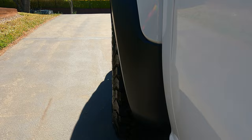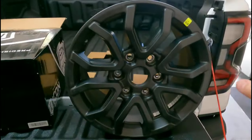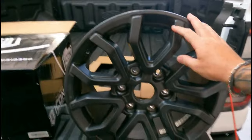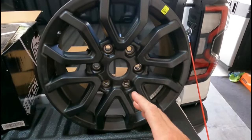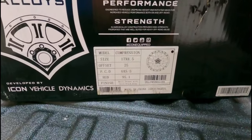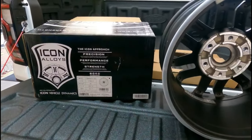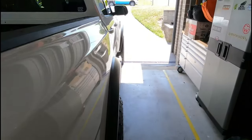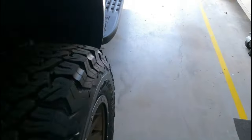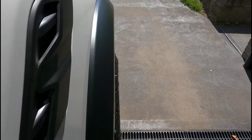What I'm gonna try and capture is what the new wheels look like when they go on. Same with the front — they just sit way too far in. These are the factory wheels. I actually don't mind the color or the design, but like all factory wheels, the offset's a bit too weak for my liking. It is a 17 by 8.5-inch wheel with a positive 55 offset. The new wheels — Icon Compression, 17 by 8.5 — it's the same width, just with a plus 25 offset. That means the new wheels sit 30mm further out, and they sit a lot nicer with the guards.